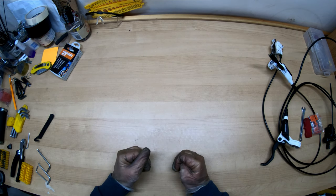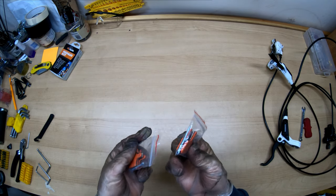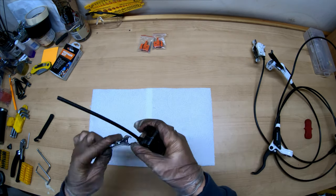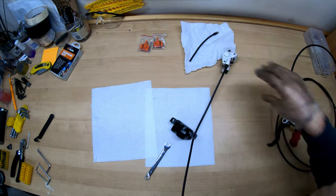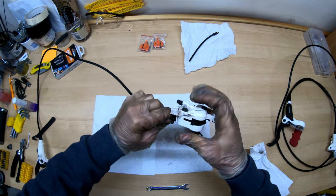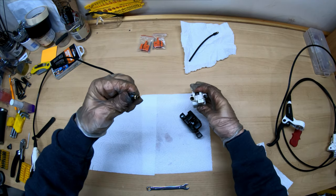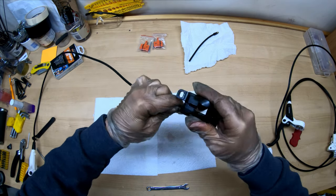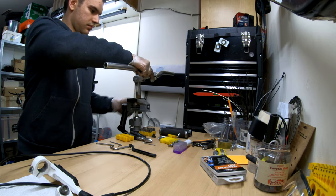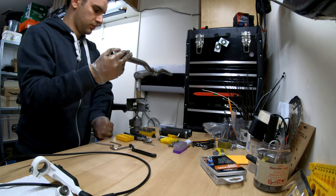For the brakes I'm gonna continue with the same gloves, and I'm going to change them when I put the new pads on and clean everything up. I will start by taking this brake caliper apart. As there is no pressure in the system I can remove the caliper without spilling any oil and screw in the other one. Then I'm going to put the handlebars on the vise — you can do this without them but it makes it a bit easier and helps keep the brake lever higher than the brake caliper.